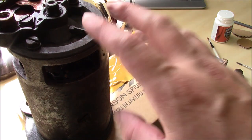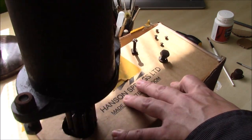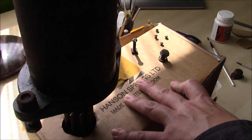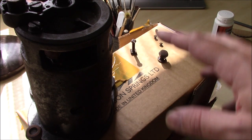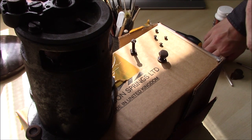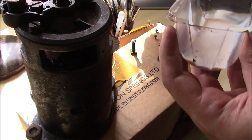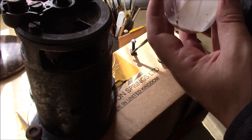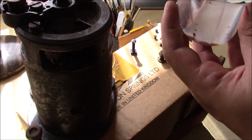So all I've done here is I've got a box and I've used a screwdriver, jabbed some suitable size holes in and then just pushed the screws in. You want the hole to be slightly smaller than the thread on the screw and then you can actually screw it into the cardboard. That just holds it for you so you can paint the heads without worrying about dropping it. For the starter motor itself, the body on this is quite difficult to hold because of its weight to actually paint it, so I've just cut a larger hole in the cardboard and that holds it upright for me. So I'm going to decant some rust treater and get these painted up. Just Q-Rust as I've used before. It's effective, it's cheap. The important thing to remember is that you decant it into a separate pot - don't use it straight out of the pot it comes in because you'll contaminate it and then it won't work.